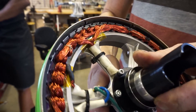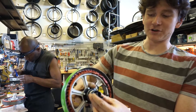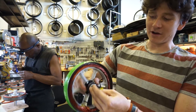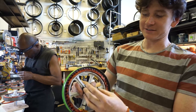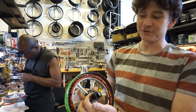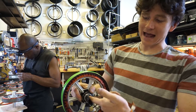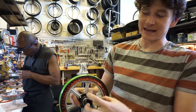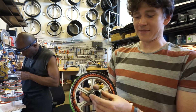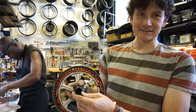There are three dowel pins retained by this aluminum sleeve. My concern with just the dowel pins alone locking the two pieces together was that with the constant back and forth of regen and thrust there could be some chance those pins might wiggle a little loose, and I didn't want them walking themselves out of the motor. The axle stops them from moving on the inside, and this retainer sleeve stops the pins from moving outward — ensuring these pieces stay effectively bonded as a single unit.